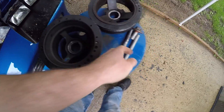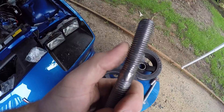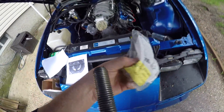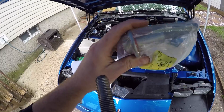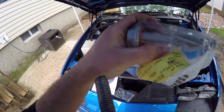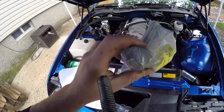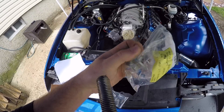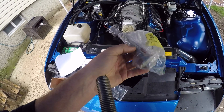The way I'm going to install this — I went ahead and took the old crank bolt, I had one laying around from when I did the cam. These are kind of one-time use; you're not supposed to reuse them because they are torque-to-yield bolts. This gets torqued to about 240 foot-pounds, it stretches a little bit, and that's it. If you have to take it off you have to replace it, because this thing will come loose. I had it come loose on me before — the pulley didn't come off, but when I went to do the cam the thing just came out by hand and I didn't even realize it.